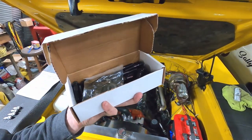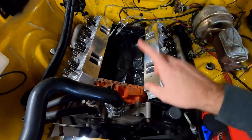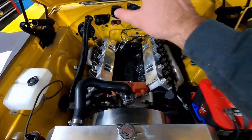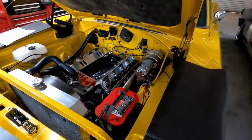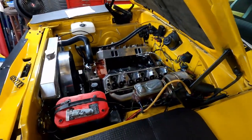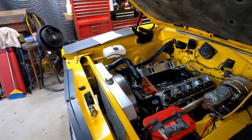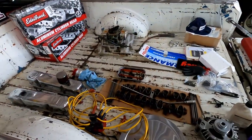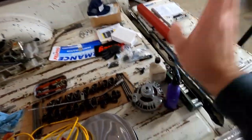It's another day here in the shop. We've been making progress on the Roadrunner. Got the other head on now that I got the other head gasket, and they've both been torqued down. Now I get to put the headers back on with our new Remflex gaskets, put the manifold back on with the carburetor, drop the distributor back in, hook up all the spark plug wires, time this sucker, and get it running. I need to put the rocker arms and everything on, verify my pushrod length, put the valve covers and intake manifold on. Let's make it happen.